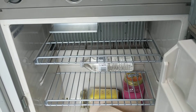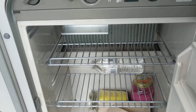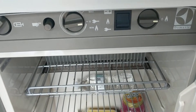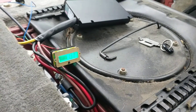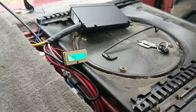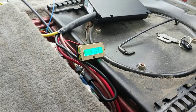The other element is 12 volts. Normally it's disabled because you don't want to run your main battery down. Originally, all these Westies never had secondary batteries. Even if you're running a secondary battery, most people do not try to run this because it is actually pulling seven amps of power. We have a 50 amp-hour battery here with our little — probably not trustworthy — meter on it. If we're doing seven amps per hour, it's going to run the battery down in about 7.7 hours. So I'm starting the clock.